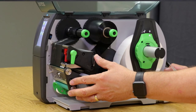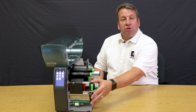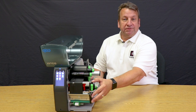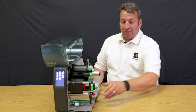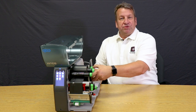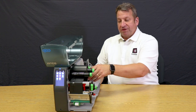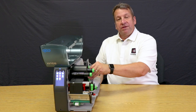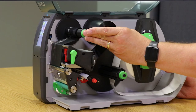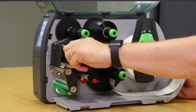The print mechanism has been rebuilt from the A4 Plus — it's much more robust and industrial. Anything green on any of the adjustments within the printer is a tracking adjustment. The green margin stop keeps your roll of labels in the printer, and the two green knobs control ribbon tension and printhead up and down.